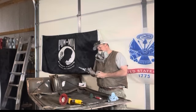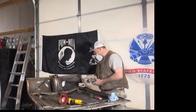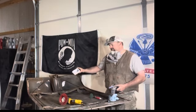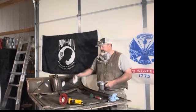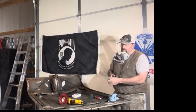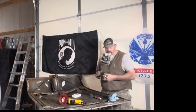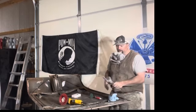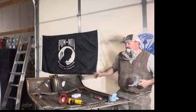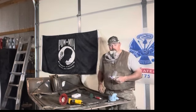The second durable tool I use — it's probably one of the best things I've purchased — is the battery-powered sander. I call them chainsaw sanders; others call them handheld belt or fine file belts, which is what 3M calls them. That's a 36 grit; I think there's a 60 on here. It will sand down welds and metal, and it's a really great tool to cut off welds when you're doing metal work on the car. I use it for bodywork, metal work, and even some of the finer sanding on inside edges, to get them smooth and prepared for epoxy primer.